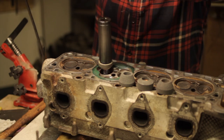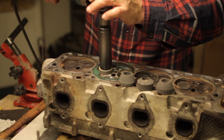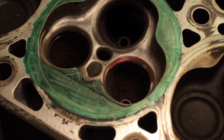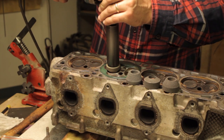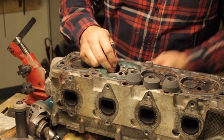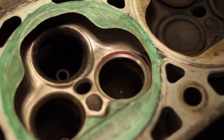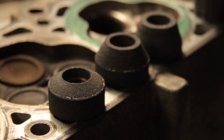You'll notice if you get off-kilter a little bit, the tool will start vibrating — you can feel it. You can see there we touched on one side of the seat and not so much in one portion. We're going to come back in with that same finishing stone and grind it in. The next step is to take the valve with the marker on it, drop it in place, and see where it removes the marker from the face of the valve. We can see it removed marker from the entire face of the valve, and now we just need to use the top and bottom cut stones to set where the seat actually contacts the valve face and the width.